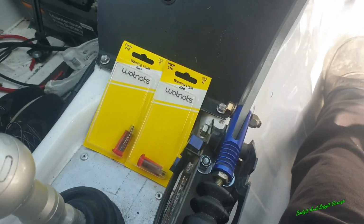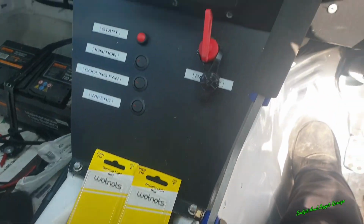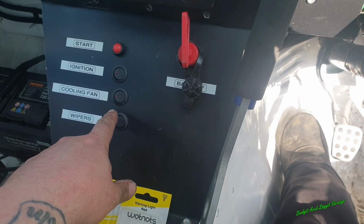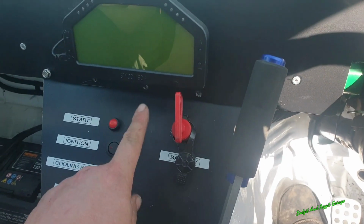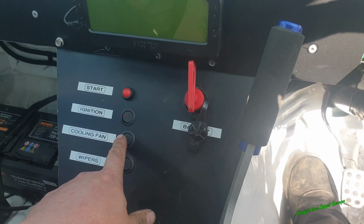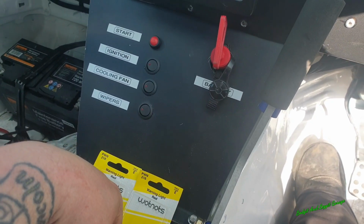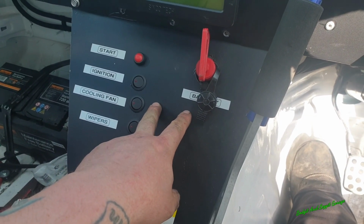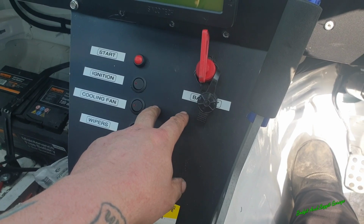Right, what I'm going to do is wire these two red lights up. Just because with the engine and the exhaust, you can never really hear the fan. Just because it's now switching on with the heat, and if I then flick it on here, you can't really hear it. So these little red lights are going to be proper indications. So I'm going to screw one here and one here, and they will actually light up when the fans are working.